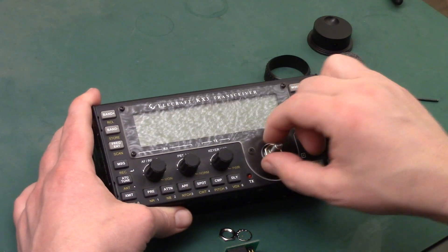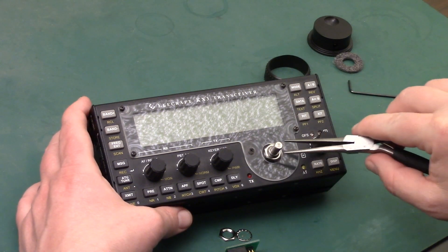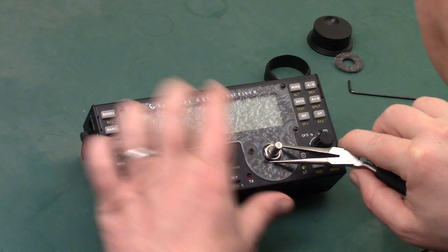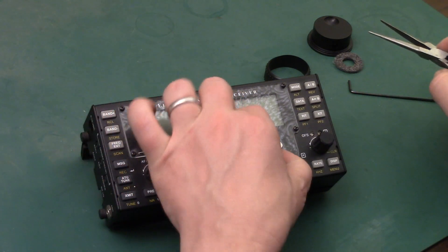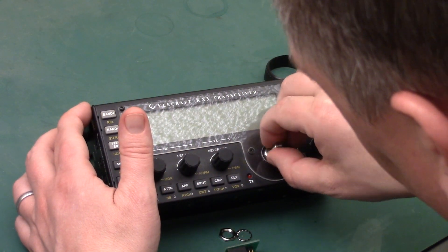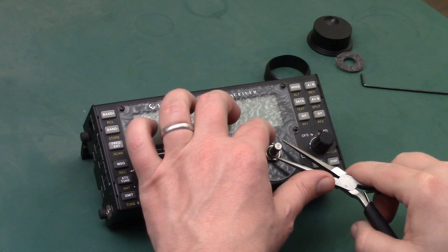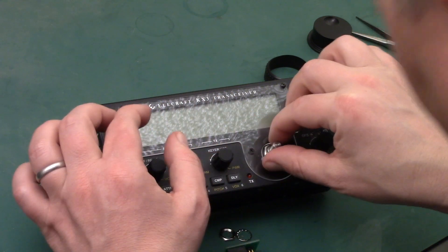You can see here's the old encoder. I'm going to go ahead and use a pair of needle nose pliers because there's not enough room between the plastic display cover and here to use a regular box end wrench. This is not really tight anyway — just enough to add a little friction — so we'll just spin it off here. It comes off pretty easily.